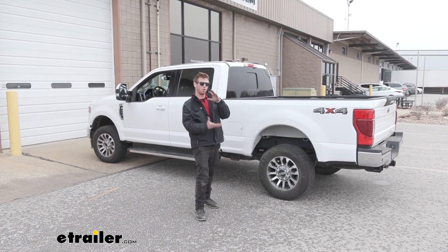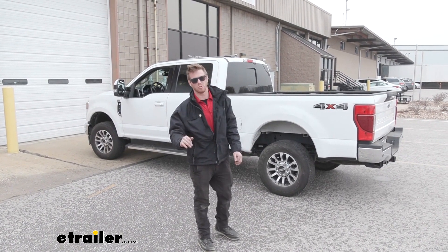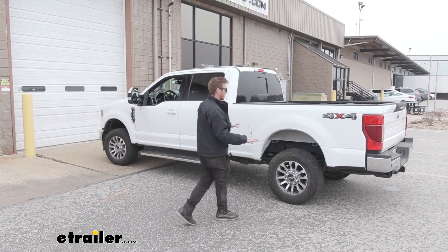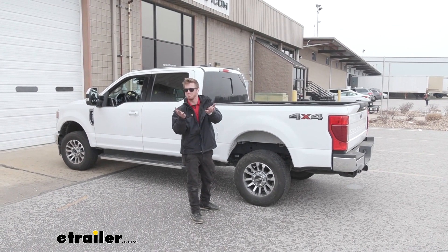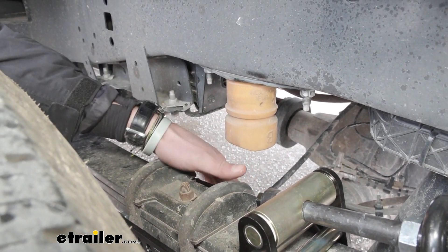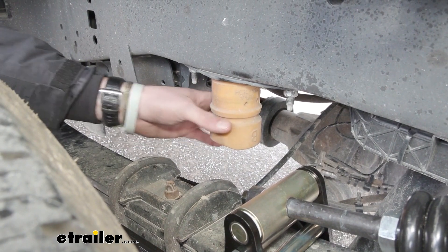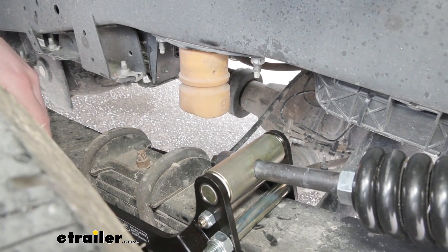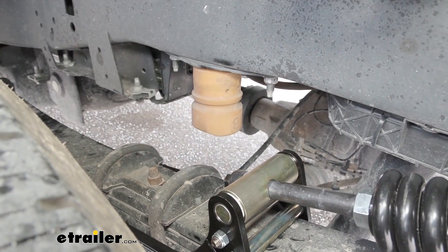Also with airbags, a lot of the time you don't have a whole lot of travel. We're not really limiting our travel here, we're just kind of beefing it up a little bit. With limited travel whenever you hit bumps, sometimes you start hopping your back end off the road — when we're not hauling something, with this we're not going to have to worry about that because it's just a little bit tighter suspension, not completely locking it in. Comparing them to upgraded bump stops, a lot of them that we sell are just a little bit bigger than this, so they start to hit the axle a little sooner — but whenever the suspension isn't sagging that much, you're not really getting the benefits of it because it's only activated when it's under load. With this, it's activated right now.